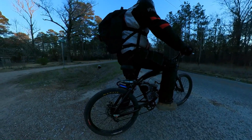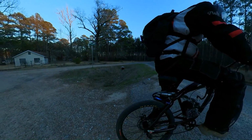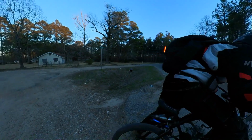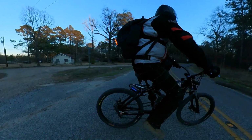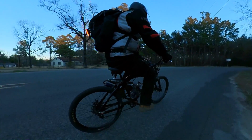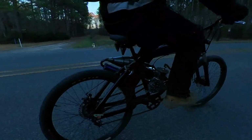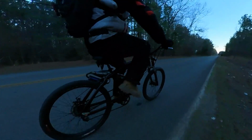And I've made probably 6 or 7 adjustments so far and I still find it to be doing this. But I'm not throwing it under the bus, as this could be due to my simple lack of experience with these high pressure clutch systems. With as much pressure as there is on these components, it's very possible that I'm simply babying the adjustments, not adding quite enough at once. Although I do suspect that the stock clutch components which I'm still using, being the mandrel, bearing, and the clutch cam, might be wearing out excessively quick. At the moment, this issue is not excessive enough to prevent me from riding the bike. I'm still able to take it to work every day, but I don't like the idea of constantly having to adjust it because the stock clutch components can't handle this much pressure.